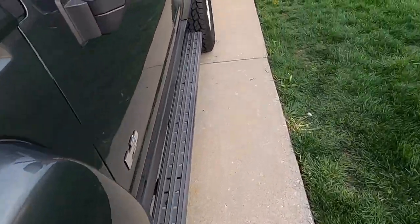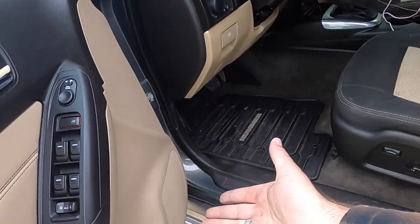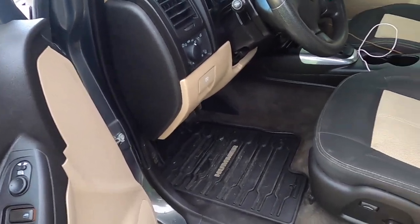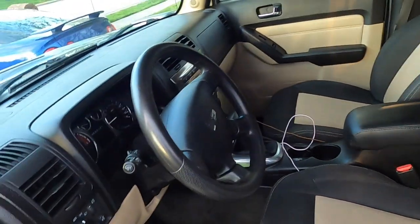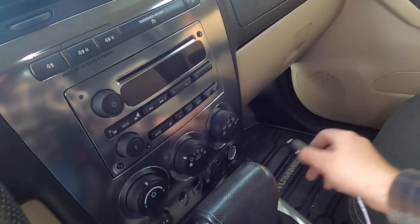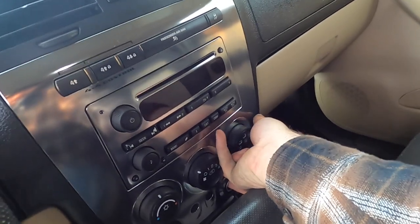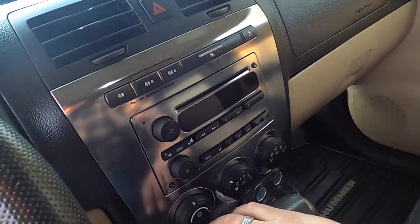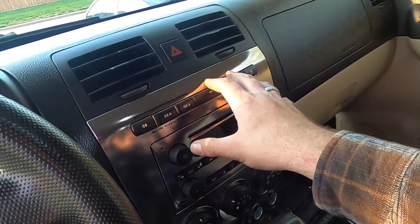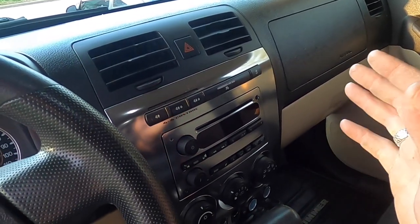Not only was this headlight fogged over but we literally have a fish tank going on in here — look at that. I don't even get it, how does that even happen? Anyway, looking much better now. It's time to move on to the stereo install. We've got all four speakers in and they sound great. My door chime actually came back since I put in the new speakers — the door chime runs through the speakers, so if any of you guys are having that kind of issue, that's the answer. Now we're going to take this off, pop off the entire faceplate, unplug everything, take out the four screws holding it in, slide the old radio out and get started installing the new one.